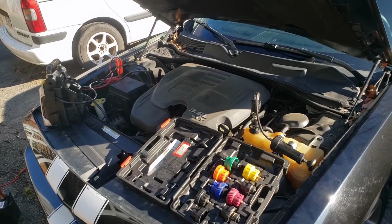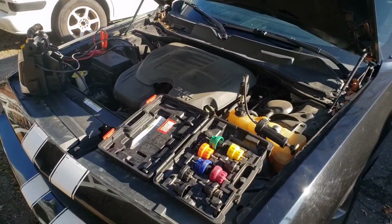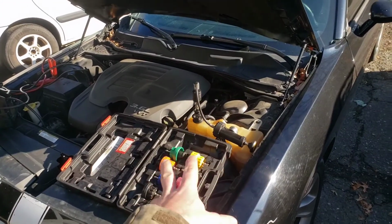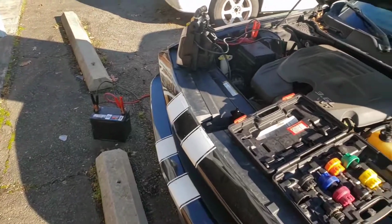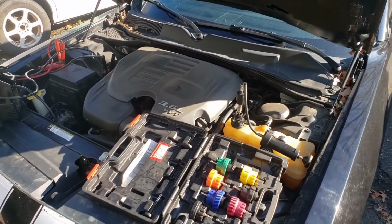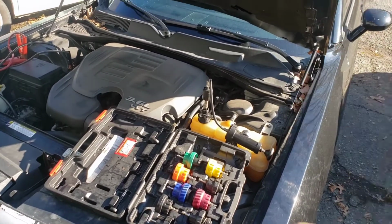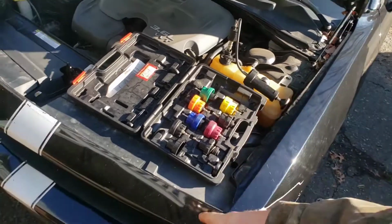They say they have a coolant leak and there's nothing actually hitting the ground. You can also, let's say you do your test like that, you can also drive the car. I might not be able to get this one to start, but you could drive it for 20-30 minutes, and then of course watch your temperature gauge, make sure it doesn't overheat, but then pull it back in your parking spot, leave it running, and come down and look under.